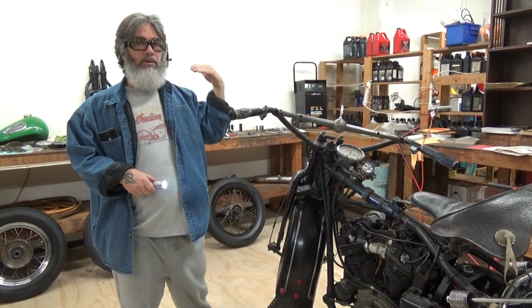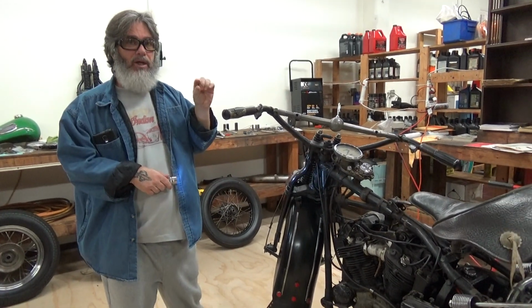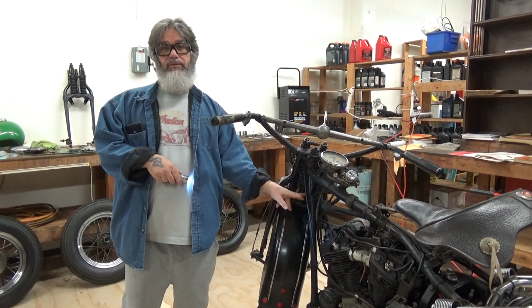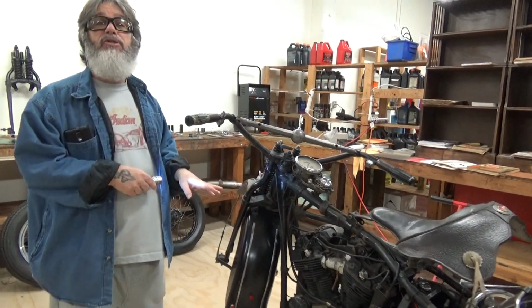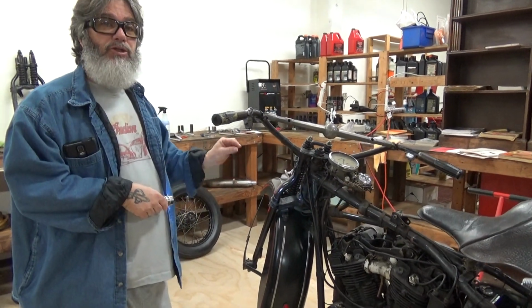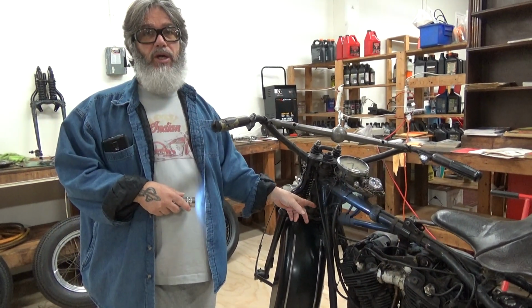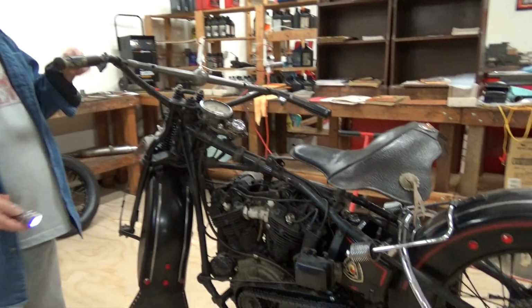Now early '38, it has a smaller check and a 2, not a 3. Same frame, just the casting hallmark's different. Okay? Late '37, same thing. Has a 2 and a small check. If you look up on Flickr, the famous James Flickr, 1937 Knucklehead restored, that beautiful red one I had, the 2 with a small check with the repaired stay.